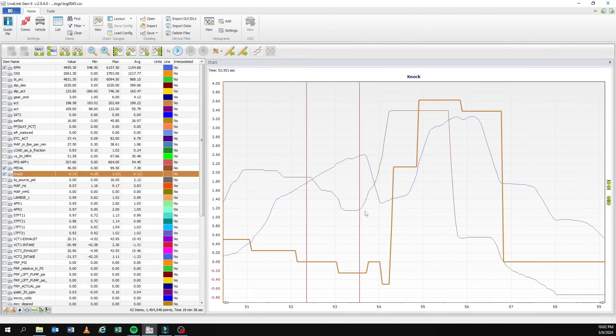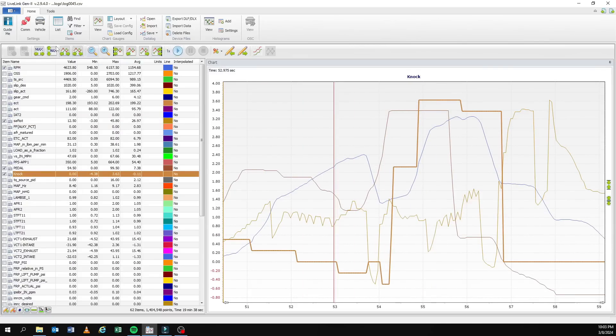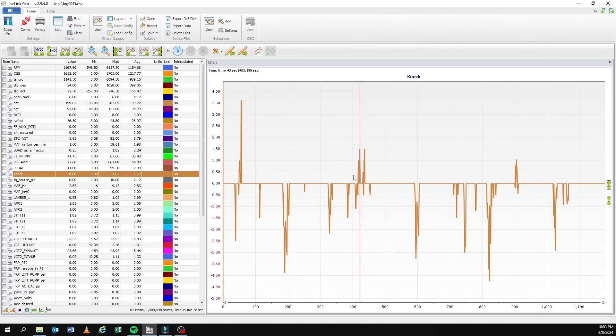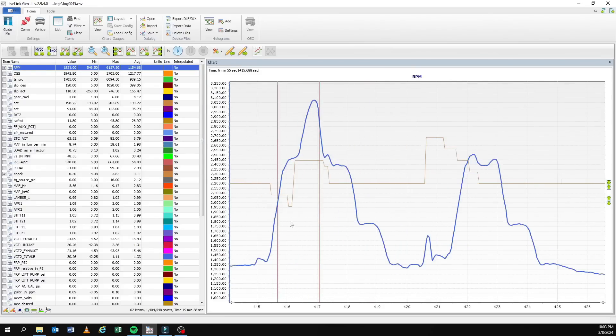Zero and negative knock is good; positive knock is not good. So here it's 3.63 degrees of knock, meaning if the car is commanding, say, 15 degrees of spark plus 3, that's 18 degrees — and it said no. But that's the adaptive octane logic doing what it's supposed to do. So this car is seeing only 15 degrees of timing and kicking back 3 degrees according to the knock sensor PID. Let's max out the view and see where else it knocked. These little blips here are where I suspect the RPMs go up when I'm stepping into it while cruising — you can hear audible detonation, like marbles rattling. That's what I would hear, and that is positive knock.